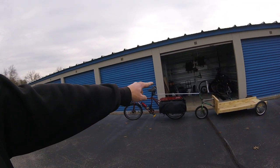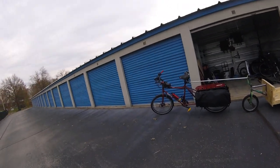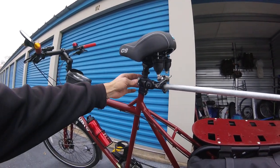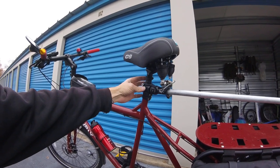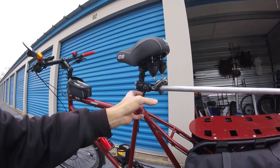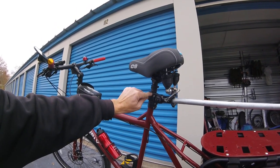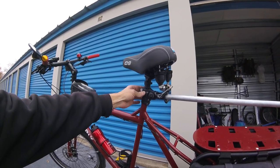You can see there's one piece of conduit — that's EMT — it connects to the Big Dummy. I used a neck from a bicycle, and what I did was I put a bolt through there with a nut on each side because I didn't clamp it tight. It has to have the ability to turn. When you're riding and you turn, it has to have the ability to flex. So what I've got on there — I don't know if you can see it — it's a plastic sleeve that I made. And I also greased it a little bit just to be sure there's no binding.